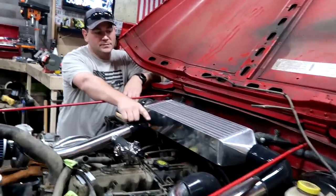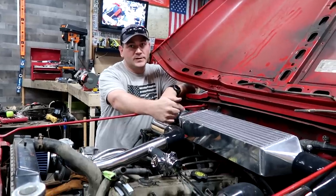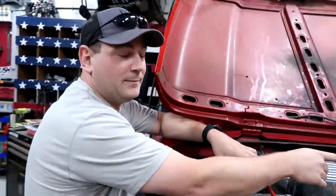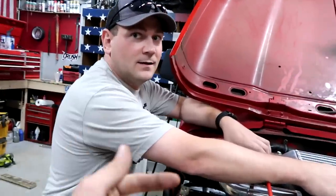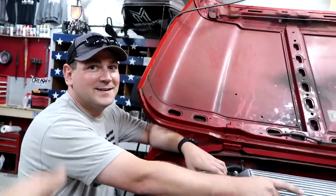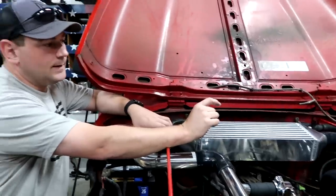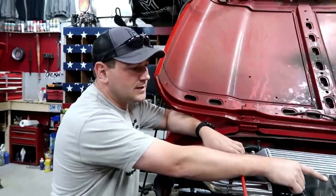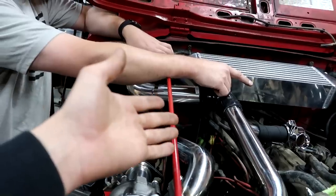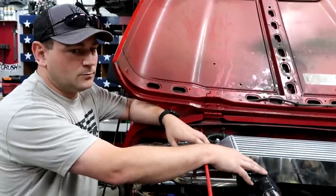The solution is that we're going to end up with a one inch body lift. So we either have to take out the three inch or four inch body lift — whatever it is, three hockey pucks and black iron pipe, and I think I saw two or three other types of material. It's like a Canadian body lift. If we get the body back down to just one inch off the frame, that angle will be much less off-kilter. We're currently going up at a 10-degree angle, but everything up here is going to clear. We just need to get the body back down where it belongs.